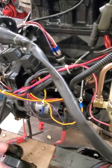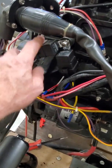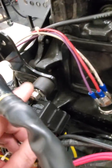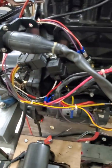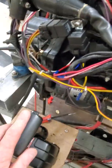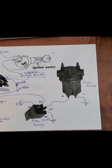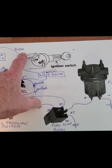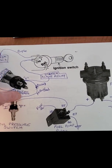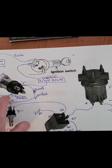Hopefully that helps. I like the idea of the three-wire oil pressure switch and then adding the second relay. The starter relay — I've just taken that rubber grommet that was on the engine. These are outboard motor mounts if you're ever looking for them — pretty inexpensive and it works great to support a relay off of the engine. I just tied off of it and tie-wrapped it up. Here's a wiring diagram of what I just showed you. You have your key switch. Off your key switch, the ignition wire — your purple wire — runs down through your engine harness and goes to the ignition coil, the alternator field wire, etc.